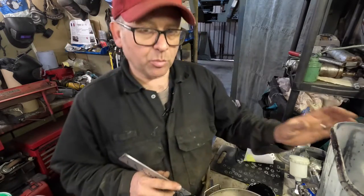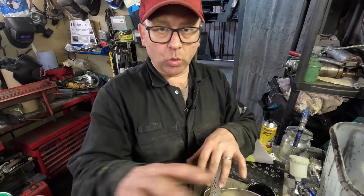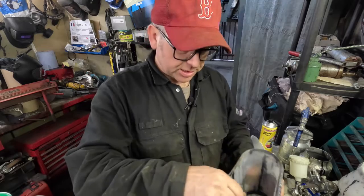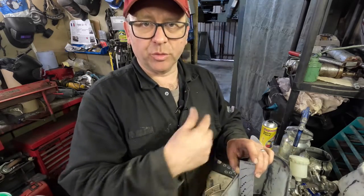In more equipped garages, you may have paint shakers. Some people even heat their paint up first, so they have like a water bath and they heat that paint to get it thinner. In here, it's a chassis. We need to just get it sprayed. Let's just get on with it. So we've now got the paint in with the thinners. I'm just going to need to mix that thoroughly. Not worth watching this. It's quite literally like watching paint dry.